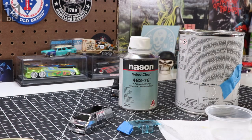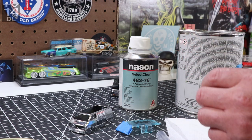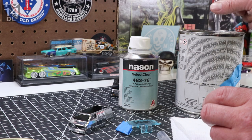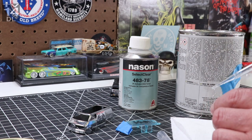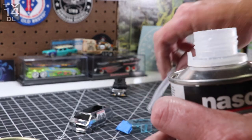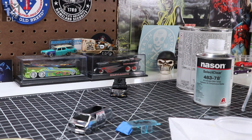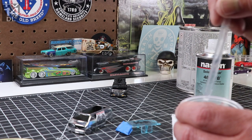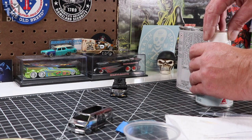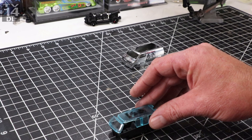I put the clear on pretty heavy. To do one vehicle, I'll mix four parts clear, one part hardener — it makes a decent amount, I could probably do a vehicle and a half with it. I've had this set up for almost a year doing a car a week and it goes a long way. The hardener I had to buy a separate one because I didn't put the lid on tight enough and it got hard. It was essentially a year's worth of material at least, and I've still got a quarter left — maybe a year and a half total. Overall, the clear, even though I layered it on pretty thick, didn't really give me the effect I was looking for. I did clear the top of the window as well, which worked out really well — I was thinking the plastic was going to melt, but it didn't.